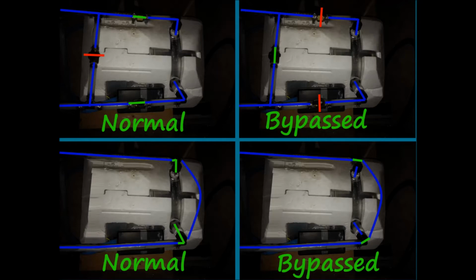Now we'll remove what little water remains in the hot water heater by bypassing that, which allows water to go past the heater without going through it. Bypassing the water heater will also save us the capacity of the hot water heater worth of antifreeze. So installing the bypass kit pays for itself the very first year. If you have inline valves like the top photos, close the heater's pipes and open the cross path. If you have the proper bypass kit, simply set both selectors to the cross path instead of the heater.